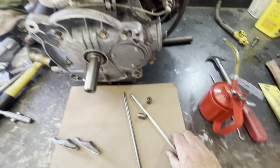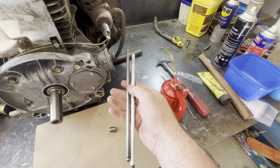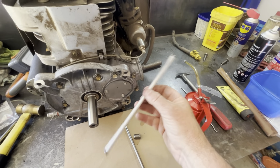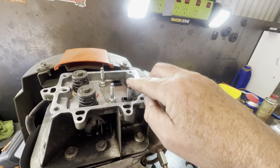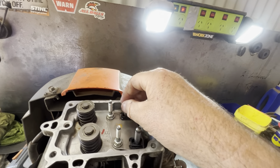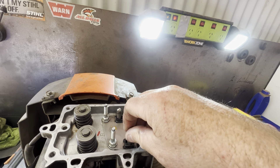Whoever was paying attention in the last video - steel and aluminium pushrod. I still don't know why they do this, I've never really looked into it. Aluminium is the intake - that's the bottom one. Exhaust is steel, to the top. Make sure they go into that - you can feel them when they are recessed properly.